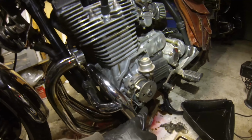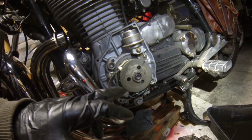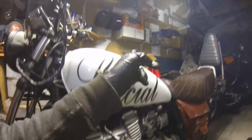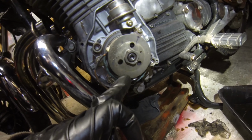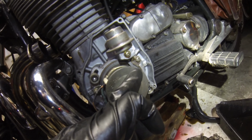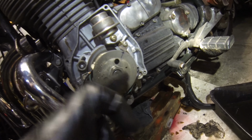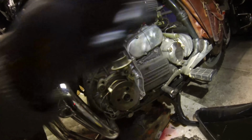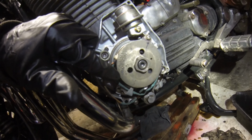But now that I've got it on the C mark, it's kind of like if you ever do one of the old Hondas, they have you put a notch in the alternator. You'll put it at top dead center, and then like 90 degrees off of that in either direction. It doesn't matter because those cylinders are one up, one down, one up, one down. So it's like a 90 degree difference or whatever.